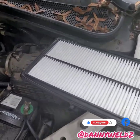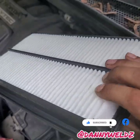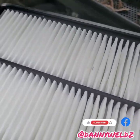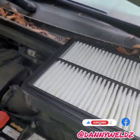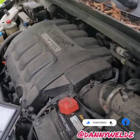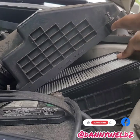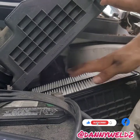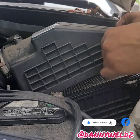There's pretty much only one way to do this. You want to pop these fins — basically the thicker side you want facing down and the flat side on top, like this. To put the air filter in, you lift this up and pop it in. Make sure it's seated correctly; there's a gasket around it so make sure everything fits up as it should.